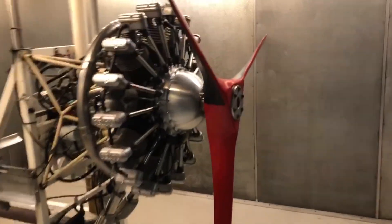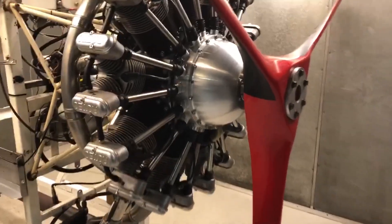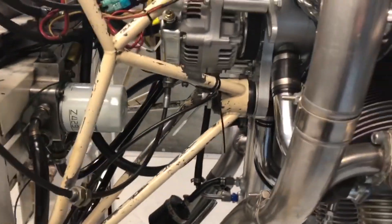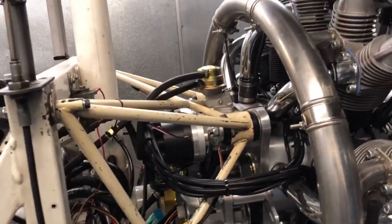Here's our test club we use. It's a three-blade prop which gives us plenty of clearance. This is a brand new engine — it's never run. I've just got a large model airplane servo there driving the mixture control on the TBI, and a control cable going through to the booth for the throttle control. This test stand has run thousands of engines so it's a little bit rugged, but it still works.